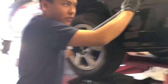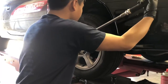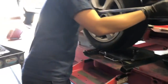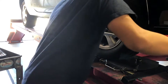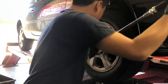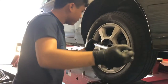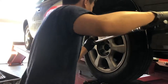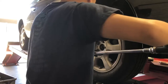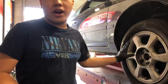Same thing as we did with the star method, but this time on the torque wrench you put one hand here and grab the other hand on the other end. Once you hear the click, it's at torque. Start method — go across, click. Click, click. Number four, number five. Now circle method to double check — that one's good, good two, there we go, and number five. Put the hubcap back on if your car has hubcaps and you're all ready to go.